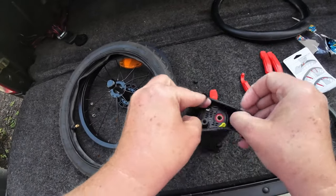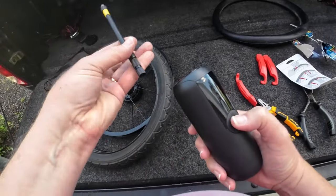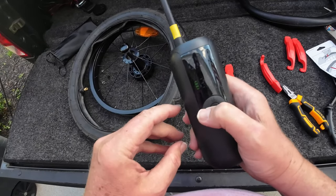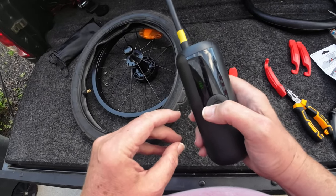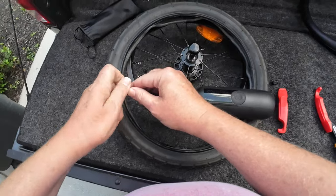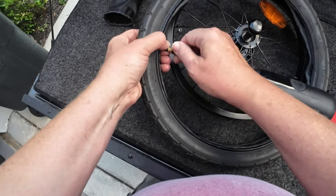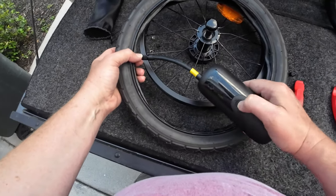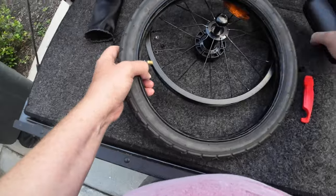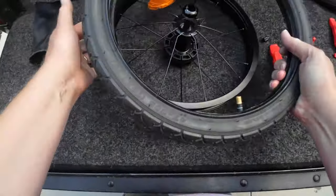My favorite little air pump right here — I got a video on that. Handy little guy, I think it was $30, maybe $40 or something, but real handy. Pull that out, screw it in right there at the top, hold the button to turn it on. The tire pressure is set for 20 — I don't want that, I'm just gonna put like a couple of pounds in it. We'll do something like that — five pounds. I had an adapter on there because the other tube was a different style valve, so I'll slip that back in the back for now. Screw this on so we have no leaky leaky, hit the button. That's actually enough right there. Unscrew that — now we can see how it sits inside there and everything took shape. That's how I plan to do it. Okay, I'm not a tire expert, but that's what I'm doing.